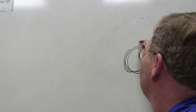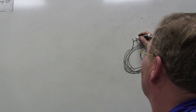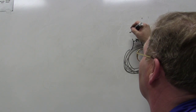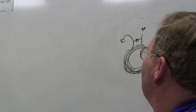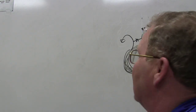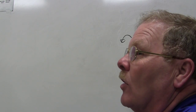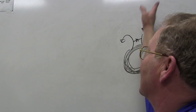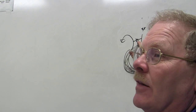You got this coil wrapped round and round, and you've got wires going to it. And you've got a diode in here that's between those two. B plus comes in here, and then you've got a ground here. What happens is, whenever this magnetic field collapses, when the relay turns off the clutch, if you don't have this clamping diode in here, you're subject to see some 400 volt spike come shooting out of this thing, and it typically makes its way through the circuits back to the engine controller and just fries it. So they put the clamping diode in there for a reason.